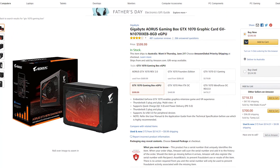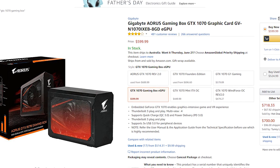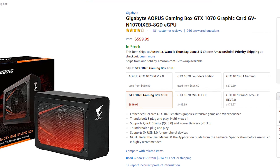We're talking MX150 or integrated graphics, which makes the RX 580 Gaming Box an upgrade only for the most basic laptop solutions — and even then I probably wouldn't recommend it. The GTX 1070 Gaming Box from Gigabyte is just $50 more than the RX 580 model, yet includes a GPU that's currently $200 more expensive on the standalone market. For just 10 percent more money you can expect at least 30 percent more performance — much better value. eGPUs are still a pretty niche product and I think they'll remain so until we see a better interface than Thunderbolt 3 that eliminates the latency penalty. I could see the RX 580 Gaming Box being a useful purchase for Mac owners, since this eGPU supports Macs whereas Nvidia's eGPUs are not officially supported, but for most Windows users I'd point you towards the GTX 1070 Gaming Box instead.